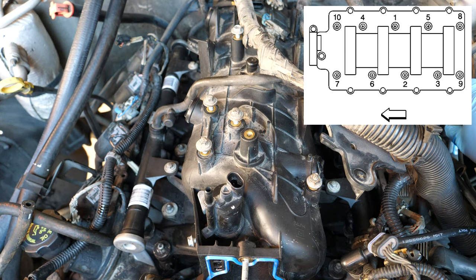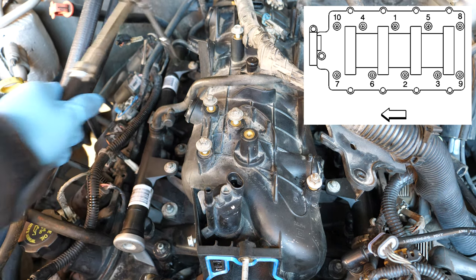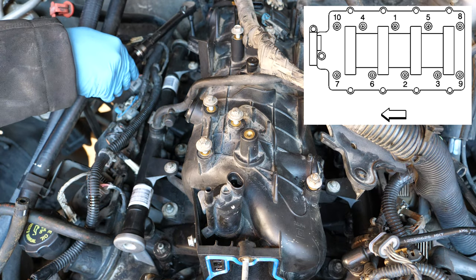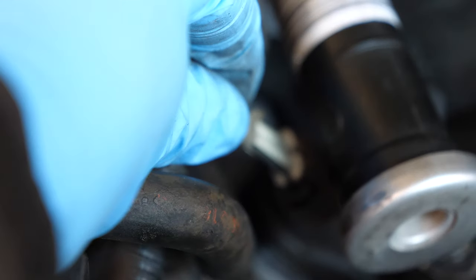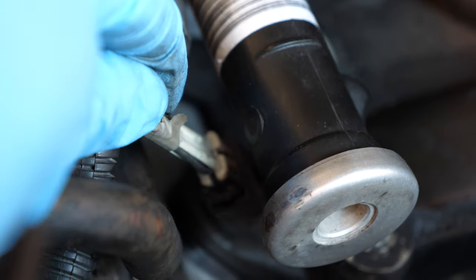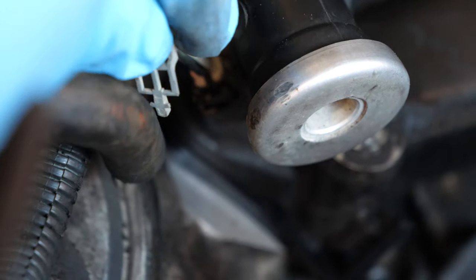Then 89 inch-pounds in the same order — one, two, three, four, five, six, seven, eight, nine, and that makes ten. From here I'm just going to go along the fuel rail and attach each injector until they click, and push in these retaining clips.